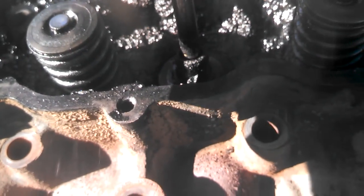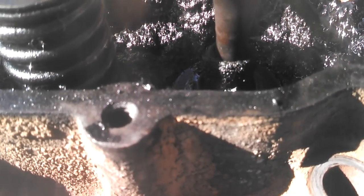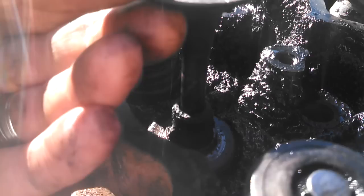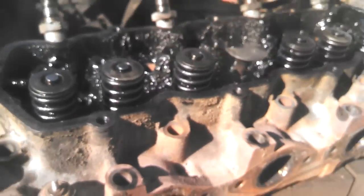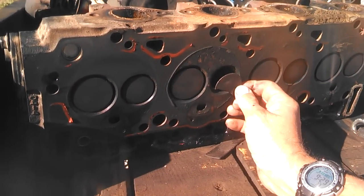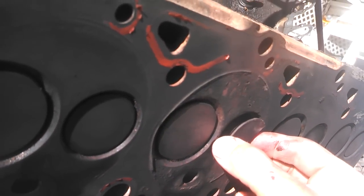So let's take a look at something. This is the valve here, the valve guide. I had been asked to do a tech on checking guide wear with the head on, but I'm not going to do that now. If you look closely, I've got quite a bit of forward and aft play — you can see it down in the guide there. This is with the valve way out, but that's a substantial amount of play. Handing the camera off — can you see it there? The valve would open about that much and there's a substantial amount of valve play, enough to cause problems.